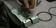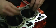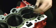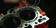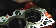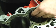Next, we gap the secondary ring using the same process — square it up in the bore. After the third grinding iteration, using the feeler gauge shows a nice drag on it, and this ring is gapped. The last thing to check is the oil rail support rings, which need at least a 15 thousandths gap. Using the 15 thousandths feeler gauge to check the gap, we have the minimum — actually a little bit looser than that, which is good.